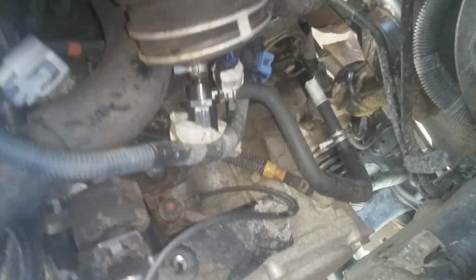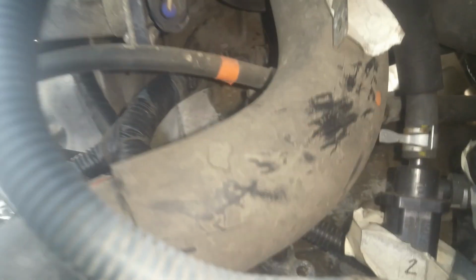We will have the shifting cable. We'll need to go ahead and remove that, and pay close attention to how this is routed and make sure that you put it back right. You can see how it routes right through here and clamps on to that transmission. And it runs down. Oh, I just pulled that off, but that's okay. It runs down under these hoses.